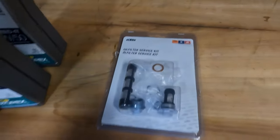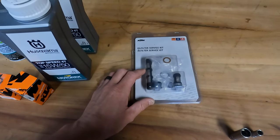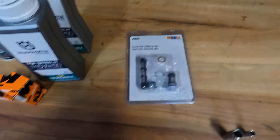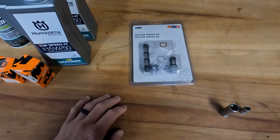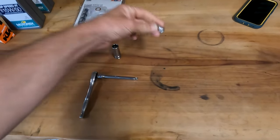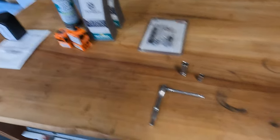I'm not going to do the screens on the first one — this is actually from the 501 anyway. You can just clean these screens. I'll probably wind up replacing them every third or fourth oil change, or if they start to look dirty, can't be cleaned, or have holes. Until then I'll keep running the same ones on the bike. As far as tools, all you really need is a 13mm and an 8mm socket, and that'll cover you for pretty much everything.